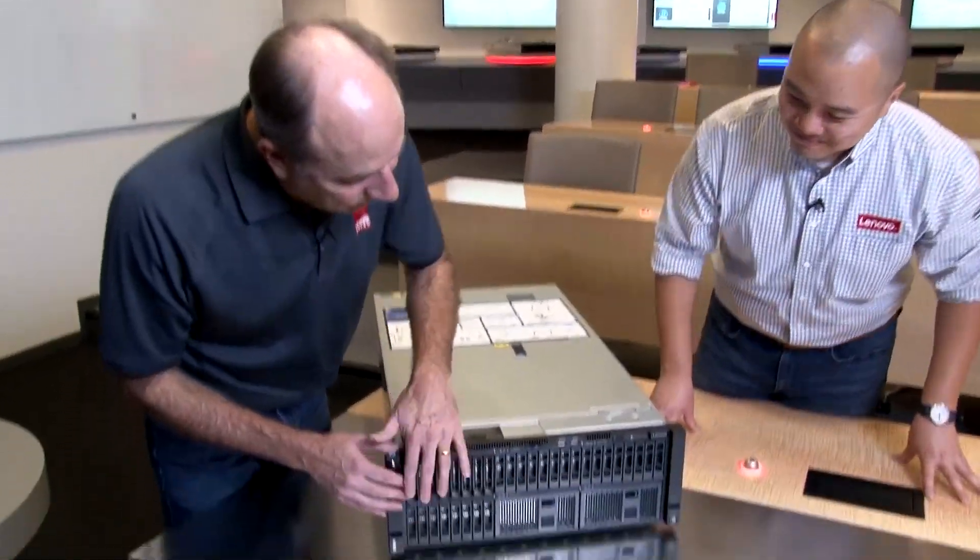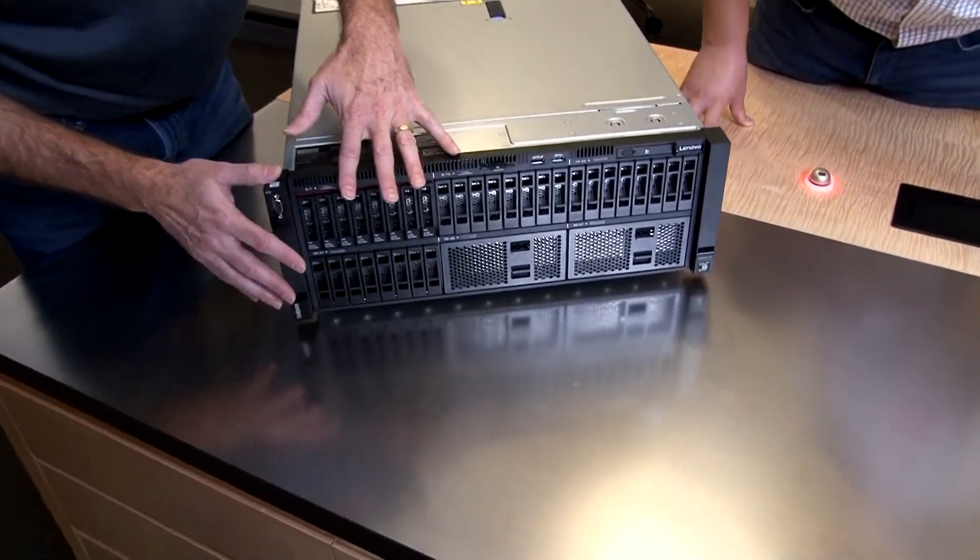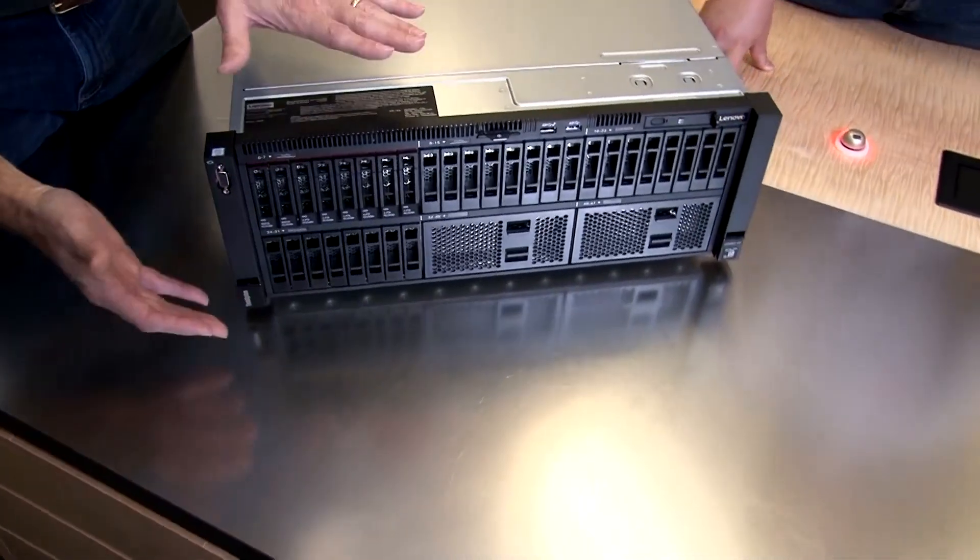You might use the 24 NVMe drives if you have a need for low-latency storage, and perhaps in a tiering configuration with the SAS/SATA drives as a separate tier. Within the system, if you're tiering off to a capacity tier and you're looking for really dense storage configurations, that's where you can really mix and match and configure it how you want. So yes, a lot of internal storage in this system, taking advantage of the four-unit space of the server.